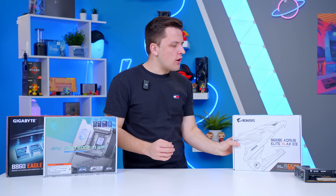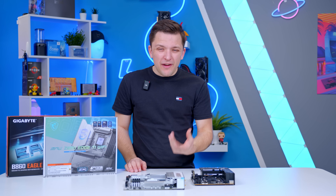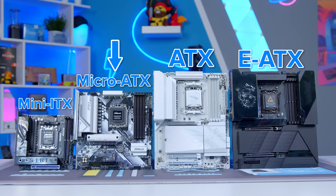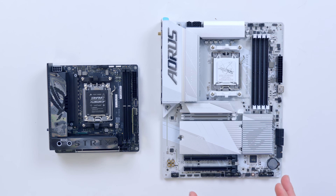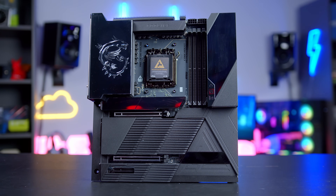The standard ATX size is what most people are going to go for, and if we compare it side by side with a mini-ITX board, you can see that the size difference is really quite remarkable. The ATX form factor is the most common, often the most cost effective, and is what most of you watching are probably going to go for. There's also a board size called micro-ATX, which sits as a bit of a middle ground. On the very low end it can provide good value for money, but a lot of cases now embrace either mini-ITX or full-size ATX, meaning the size and money you save may not translate into your case choice. The extended ATX form factor is really reserved for high-end enthusiast boards — for the vast majority of uses, it's just overkill.